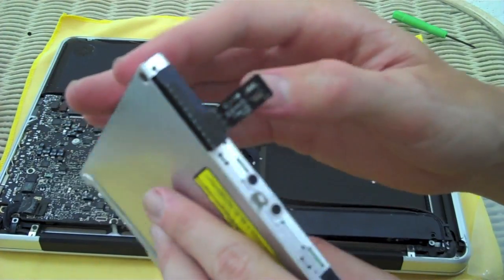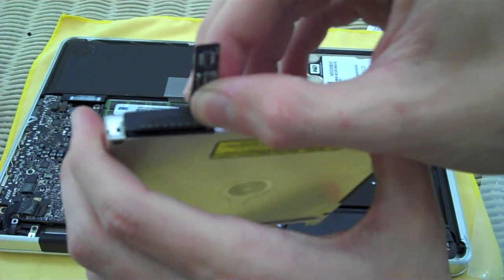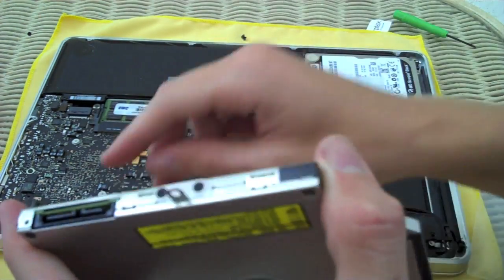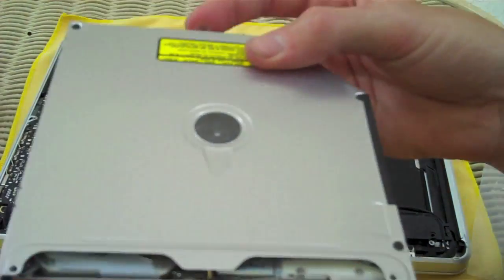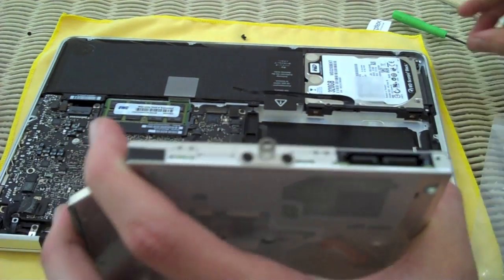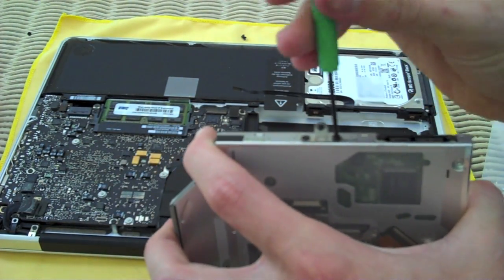On the actual optical bay itself, you're going to see this wire sticking out — give it a gentle tug and it'll come out just like this. We're going to need this piece in a little bit. In addition to this data cable, you're going to need this little bracket that sticks out to the side — that's where one of the screws attaches. We're going to use that same screwdriver, remove those two screws, and set that small piece of hardware aside.